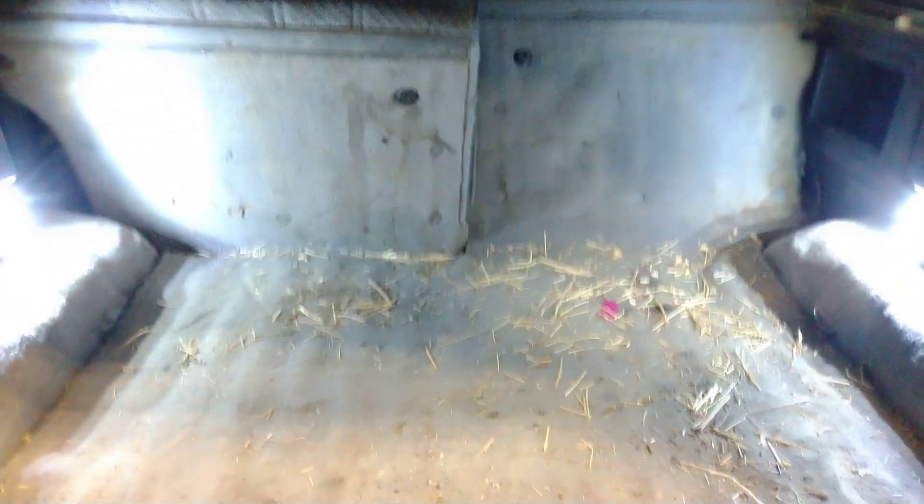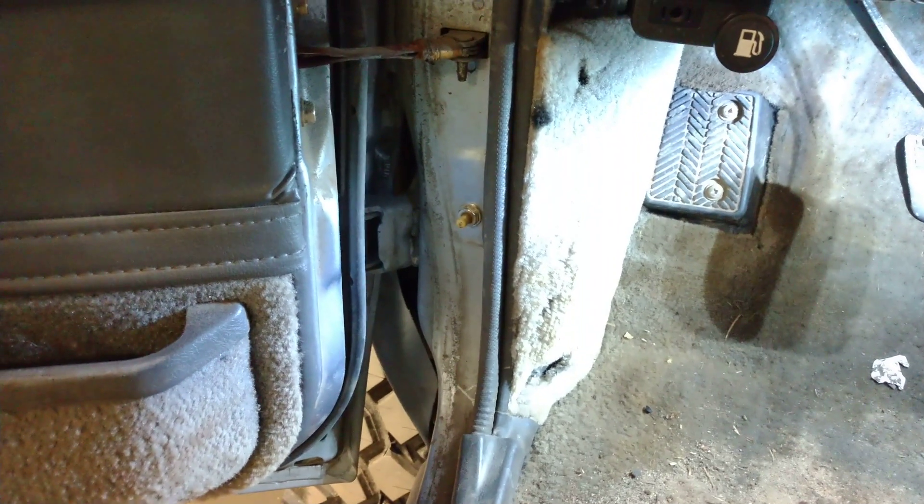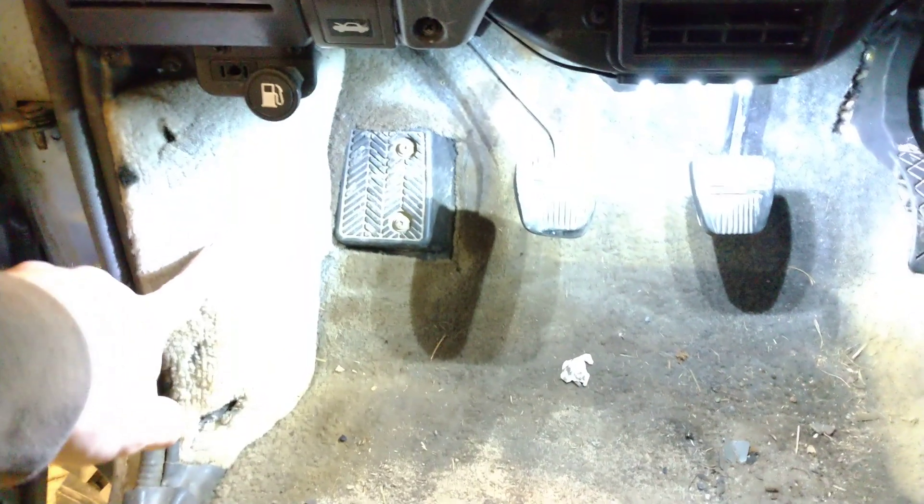I've got another master electric door like this in my parts pile — I'm gonna see if that card is in better shape or at least take some pieces off it. The master switches still work, all functions are working, which is awesome. I ran leads up to the cargo area as well, so when I open the door it'll light it up. It's really easy to tap into these systems. The switch on the door is a ground switch — they're finicky like that because they're a really crappy design, but you can buy new ones for about 12 to 13 bucks.